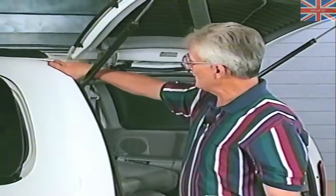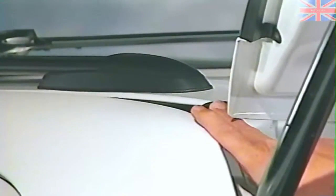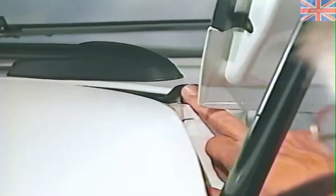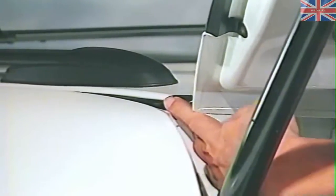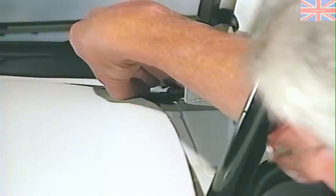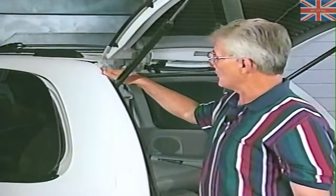Now let's talk about the wrap joint, roof to aperture. This is a seam that runs the entire length of the car, fore and aft, covered by a molding. We can go underneath the molding, raising it gently so as not to disturb the adhesive material under. What we're doing is looking for a pinhole or a weld burn hole.